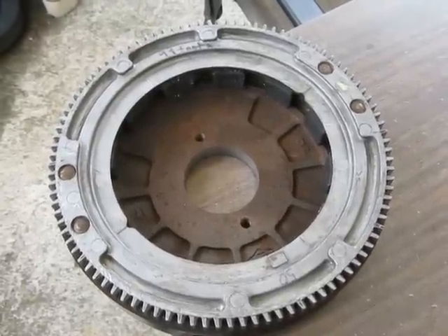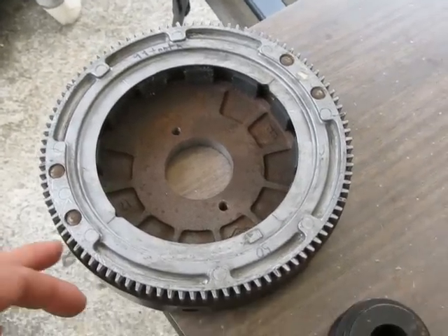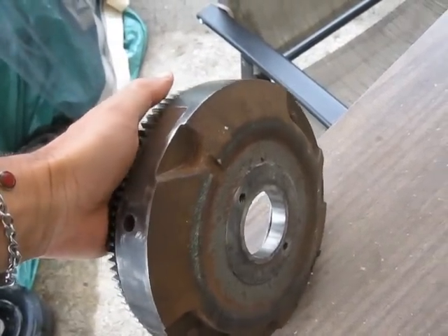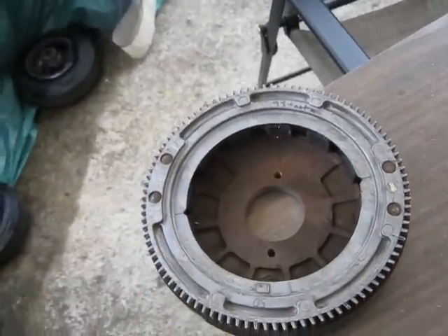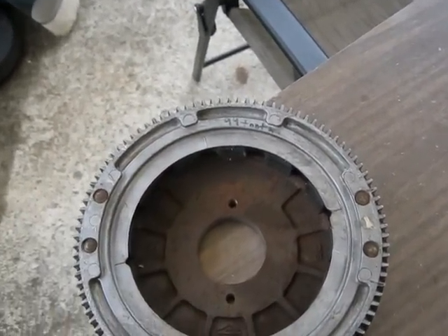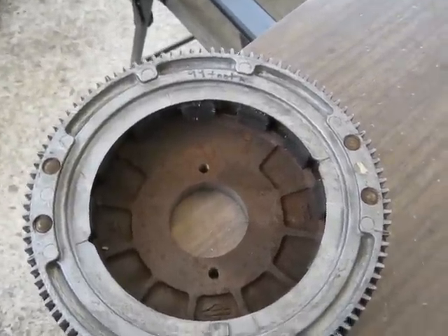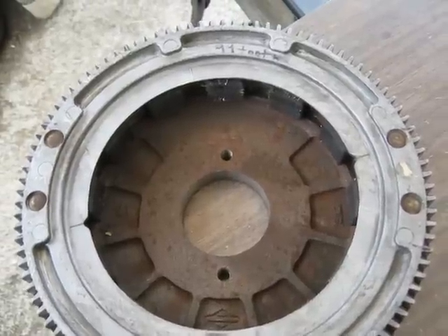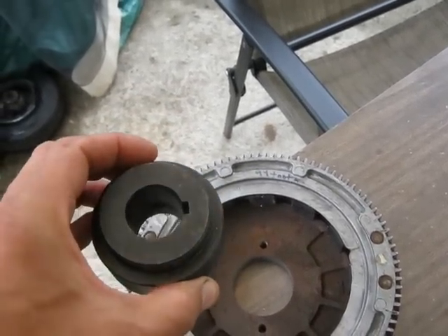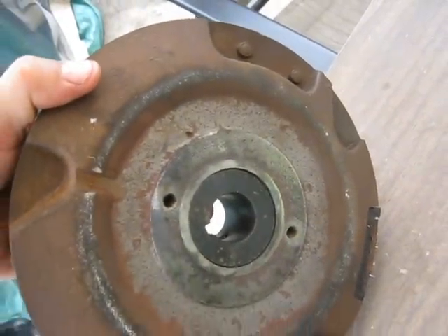Got some good news on the straight-eight Briggs front. I was able to get the end flywheel with the starter ring gear on it to the machine. It's a big Briggs, like a 12-horse flywheel that used to have separate plastic fins, but I don't need them for this application. The problem was that the shaft was tapered as all Briggs and other flywheel shafts are, and I have a straight shaft mounted on it. There wasn't enough material to just bore it out and put a keyway in it, so I bored it out and I'm going to get a one-inch X-type hub welded in there.